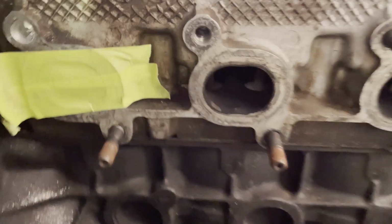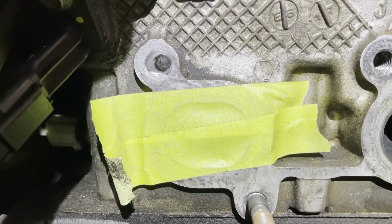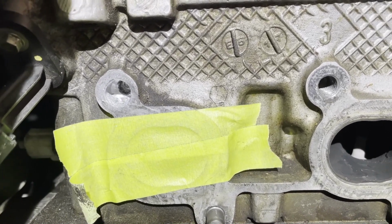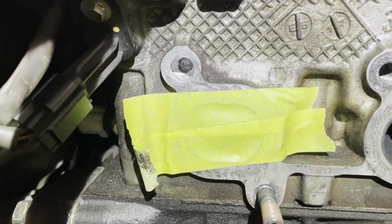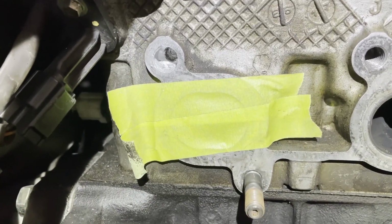Stage 1 is done. I've just drilled out the hole with the correct size drill bit to run the tap through. Trying real hard not to go too far or go into a water jacket or something. I reckon I'm just going to put the thread as close to the face of the head as I can, and just run the tap there. Oh, and use a shorter bolt instead of going all the way through. I really don't want to mess this one up.